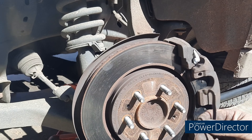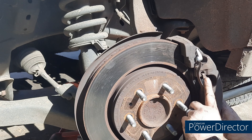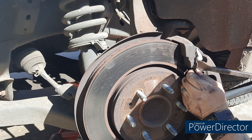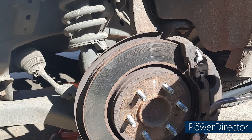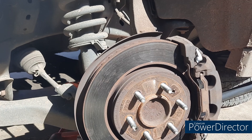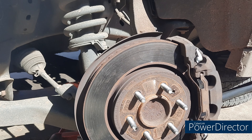The last part: you're going to put this retainer clip on. It has two tabs that go into spots top and bottom, with an ear that holds back on each side. Just tap it in there — it locks everything together and makes it nice and secure. Other than that, this rotor probably wouldn't hurt to be replaced, it's got a gouge right there, but you can just clean it up with brake cleaner, put your wheel back on, and you're set.